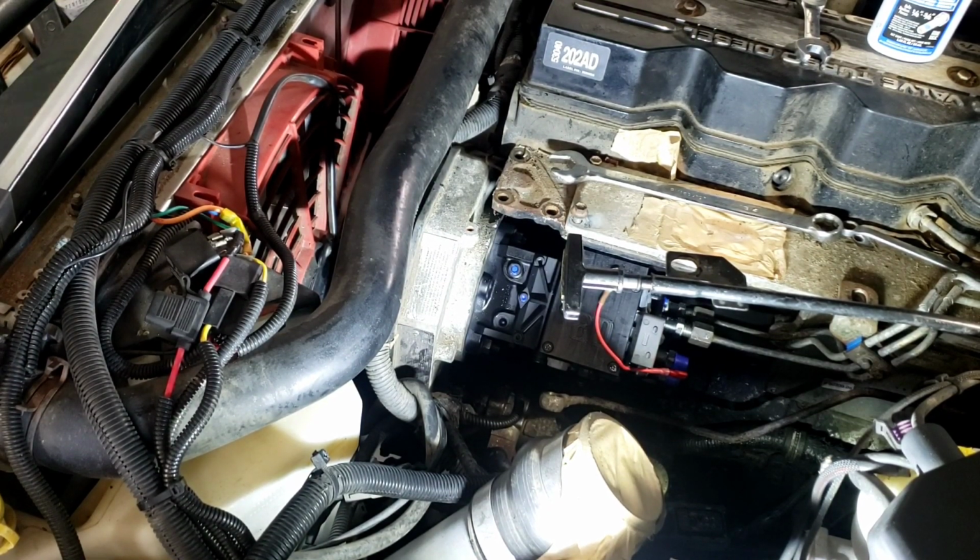Either way, that shouldn't even go anywhere, even if there wasn't a keyway in it at all. I was going to try to take some pictures of the keyway. The keyway in it was at a little bit of an angle on this one, and I had to go back and fix it a couple times. It's still not perfectly flat, but it can't slide out the back. The gear covers the whole keyway, so if it ever gets problems, I'll know what the problem is there.